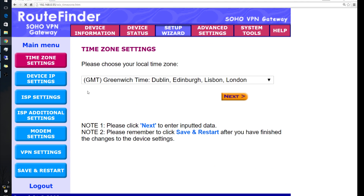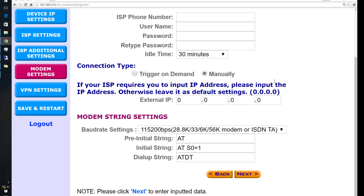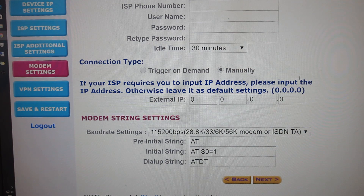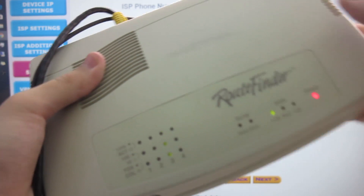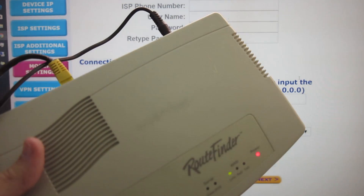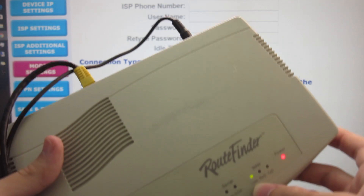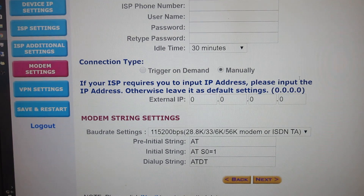It's quite nostalgic just how everything appears. Unfortunately, taking the router out from under the desk, you can see the LAN LEDs are on, but the WAN link LEDs are on even though there's no WAN cable connected. Sometimes with the cable connected it shows just the link LEDs, sometimes all three. But one thing's for sure — it does not seem to be establishing a 10/100 link to any modem or device connected, which means at the moment it's basically just acting as a network switch.